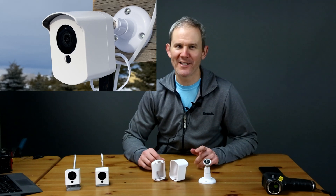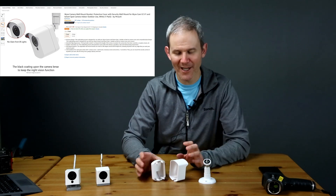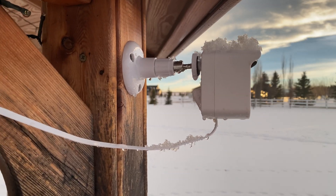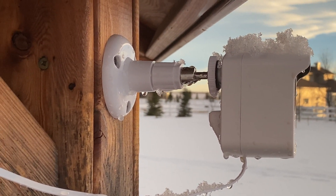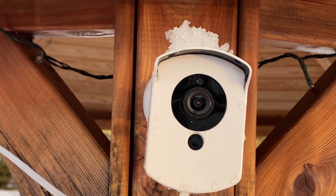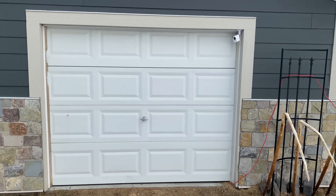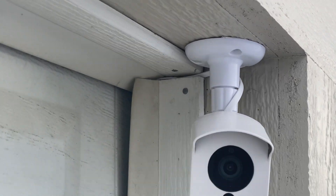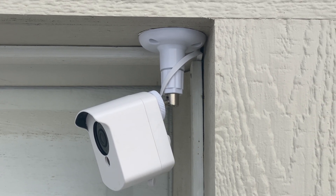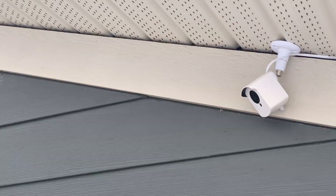For my outdoor testing today, I'll be dressing up the Wyze Cam version 2 in a very special protective outdoor housing. These housings are available on Amazon for about $12 US, which is just under half the cost of a new camera. The purpose of the cover is not to make the camera completely waterproof or bulletproof, but rather to divert rain and snow away from the openings which could cause internal damage. It's best to install the camera in a tucked away area like a greenhouse, under an eave, or in a door frame.